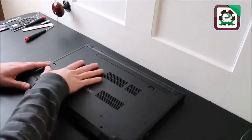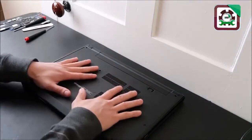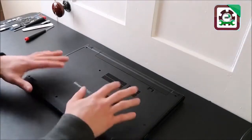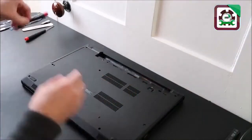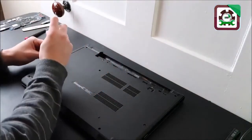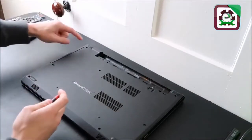In my computer I don't have an easy panel — I have to take off my entire bottom case. Unless yours is somewhat similar to this, it may be worth looking up a disassembly video on your specific computer so you limit your chances of breaking anything. I'm going to take off my battery and start removing screws. If you can't find a disassembly video, watch out for a few things.